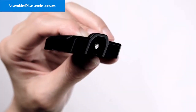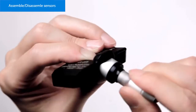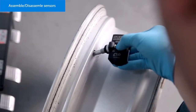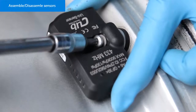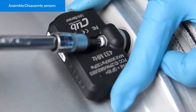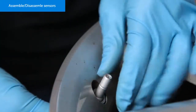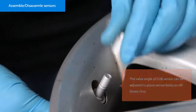While holding the TPMS sensor body, with the plastic side of the TPMS sensor facing the tyre, push the TPMS sensor valve stem through the rim by hand until the TPMS rubber washer meets inside the edge of the rim. Lock the TPMS sensor and the valve stem assembly together by screw. Hold the TPMS sensor body down against the rim drop centre.